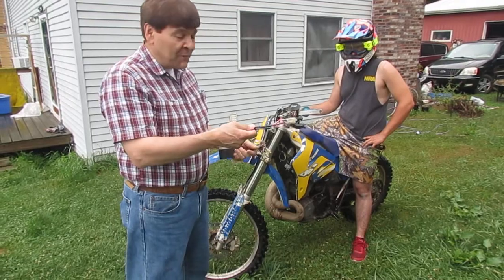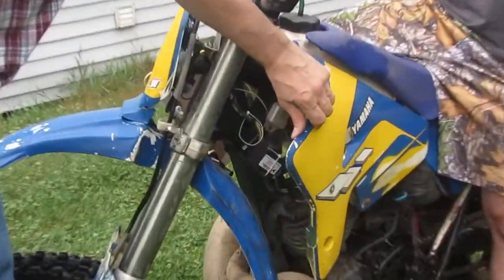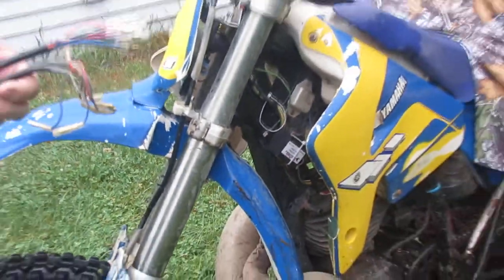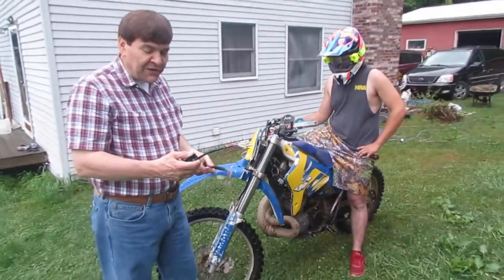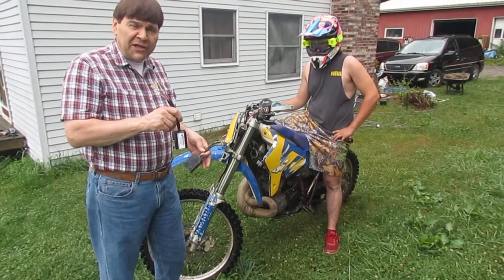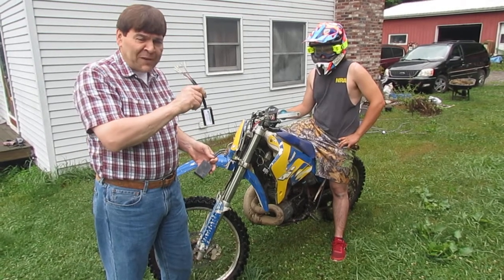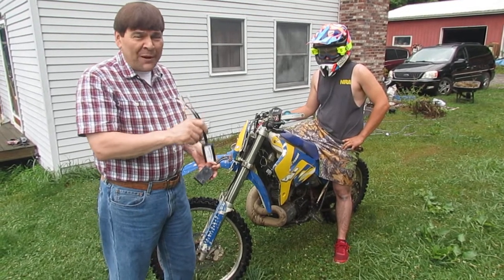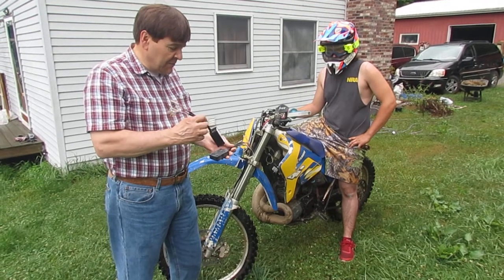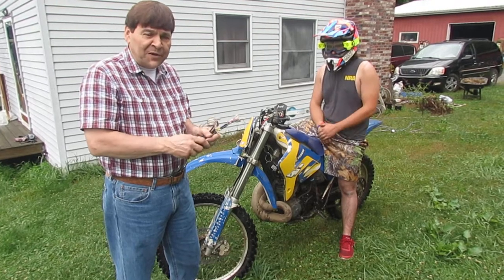It's much better than the OEM. We got it installed down here, getting ready to go. You're going to notice a difference on this CDI on the top end. The timing rolls out starting at around 7,500 RPM. This new CDI maps that perfectly to the OEM CDI — from 7,500 to 9,000 it goes from about 15.5 degrees down to about 1 degree. Mike gave it a try and said it's really smooth on the top end and much better than the original.